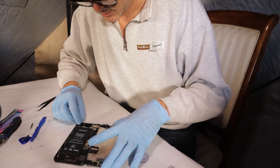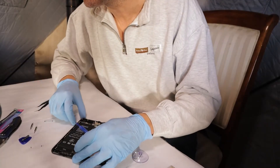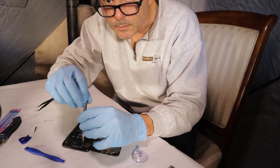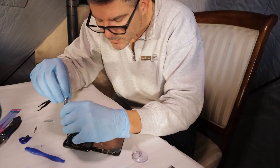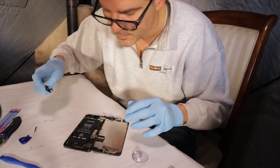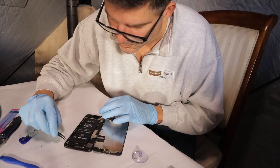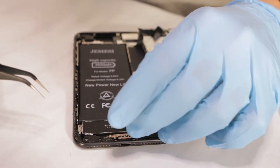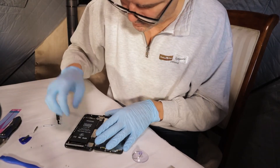There's our battery. So maybe we don't have to take everything out today. I remember we take out this front bracket here. Use a little screwdriver. We'll keep track of all of our screws here. These look short and there's three of them. I could actually do a drawing of where everything is, but you know, we're pros at this by now. So we'll take this chip out and remove it. There's our battery.